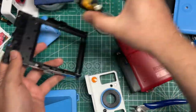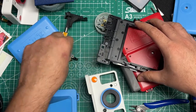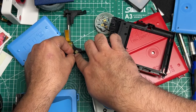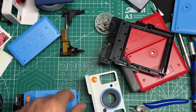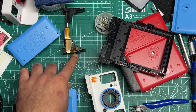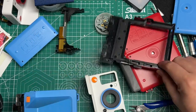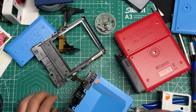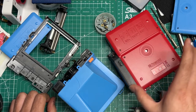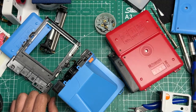This is all basically what you need here. Then follow my wiring diagram, and obviously solder something on here and solder new points onto the motor. Then you want to sever this connection once you do your rewiring — I'm just leaving it on there right now so I don't lose it, so remember to sever that off. Otherwise if you're putting in juice there's going to be more juice coming in here, and I'm not sure what the diagram is for this so I don't want to risk that. Hopefully that was useful — stay tuned. I will be releasing the full instructions and files for this one; I just need to focus on the framing and tweak it a little bit more, and then that will be the first version release.